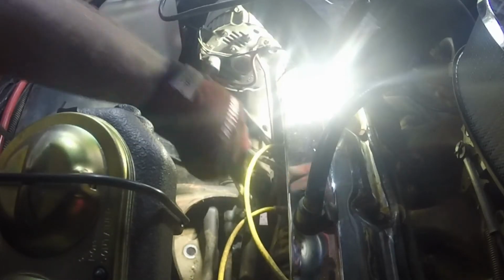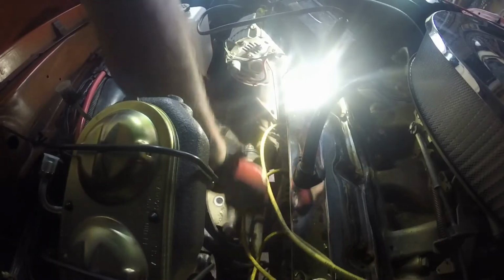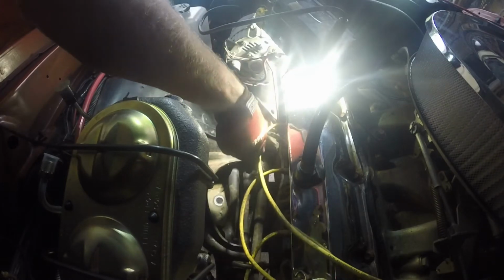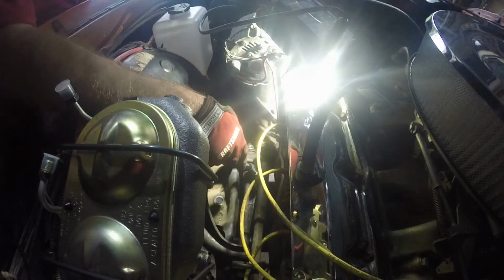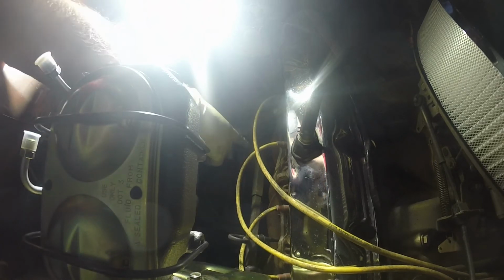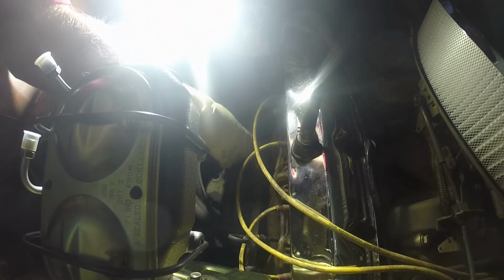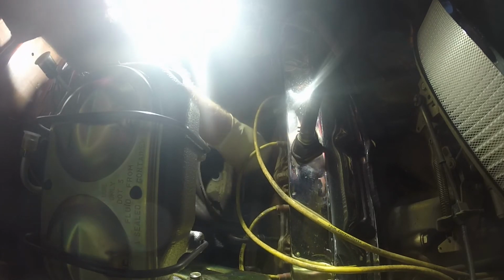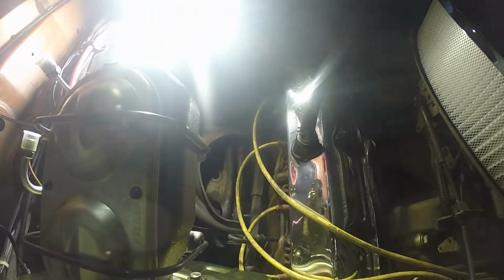And we're gonna continue to take this out shortly. All right, got one of these ratcheting wrenches. Should make quick work of this, I hope. All right, so we unwound these nuts just far enough where they're flush with the bolts here, and that will give us enough room and protection for the threads when we hit these with a hammer to unseat the bolts.